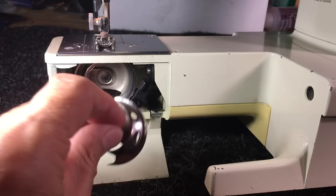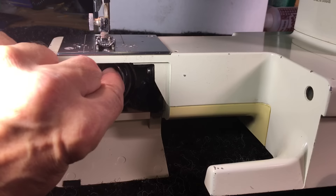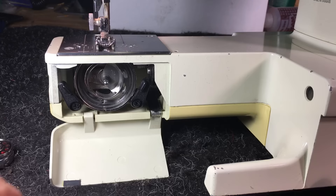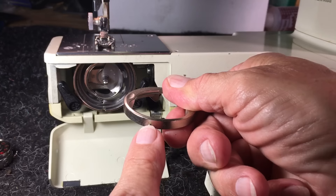With the needle at its highest point, you have the C — the hook driver on the left — and this is the other half of the circle on the right-hand side. With the needle at its highest point, you set that in with the needle hook point pointing down. Then you have your retainer ring. You see the little indents where your ears are going to swing over on both sides — those will be pointing out.